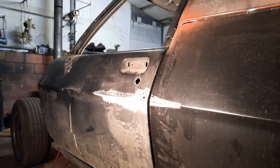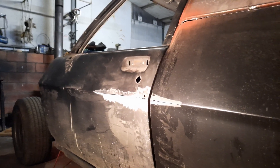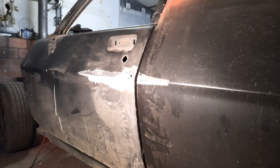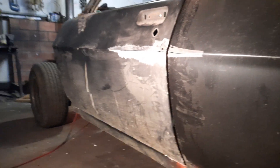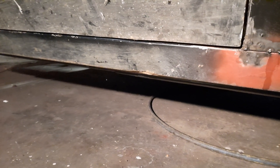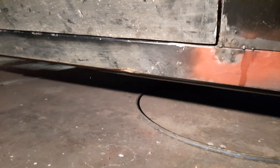But the quarter panel was still a quarter inch too high at the crease. I've got the door as high as I can get it, as high as it'll go, and I've got too much of a gap down the bottom. It should be about a quarter inch gap — it's close to three-eighths, nearly ten mil.